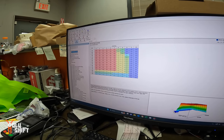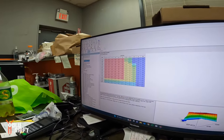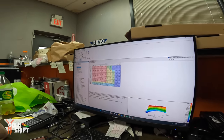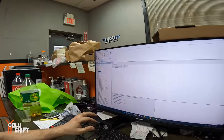Not much. But then we're going to run auto-tune sessions. Your philosophy is what? I want reliability, and I want the bikes to run at a good temperature. Getting high numbers usually means you have to keep it really lean, with advanced timing, and you compromise reliability long term, right? Yeah, and with 4 or 5 points, you're not going to see that difference. Right. Okay.